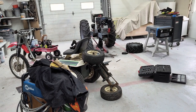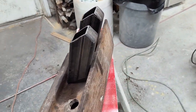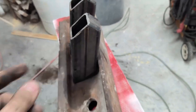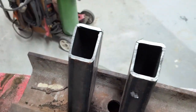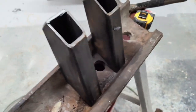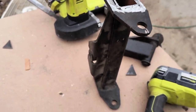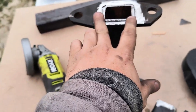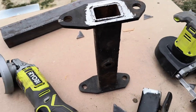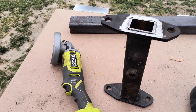I'm doing work on lifting the front end of the Sears and this is what I got so far — two 45-degree angles and then bent this top. I think they'll work pretty well; they're both symmetrical. Both are gonna get welded here but not yet because I'm welding to this right here. I'm hoping I can just fit it right over top of this little ledge, tack a couple of welds, make sure it's level, make sure everything's good, and then weld the rest of it. Should work — fingers crossed.